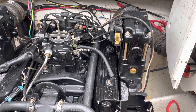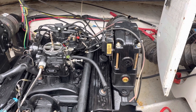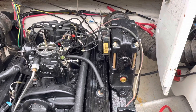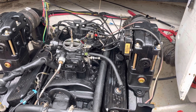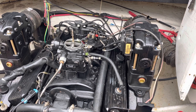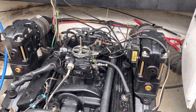So now I'm cranking on one battery and running the ignition and all the lower electrical consuming devices on a different battery. My reasoning was that this would keep the ignition hot and get a hotter spark because I've got a full 12 volts on the ignition system all the time. And it seemed to work a little bit — it went from not popping at all and just freewheeling to starting to pop a little bit, but it still wouldn't start up. That's when I decided something else was wrong.